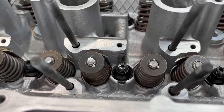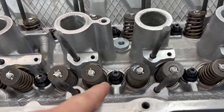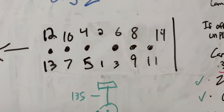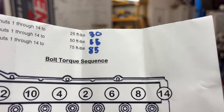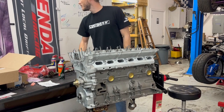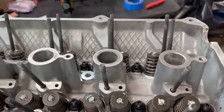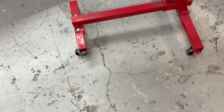All the hardware is lubricated and hand tight. The washers are clean and dry on the bottom, threads are lubricated, nuts are lubricated — we are good to go with the torque sequence. I never remember it so it's always on the board. Here's the sequence, and here's what we're doing: 30, 55, 85 foot pounds. 30 goes quick, let's move on to 55.